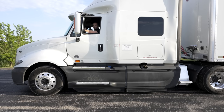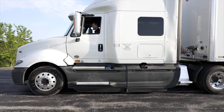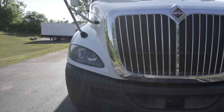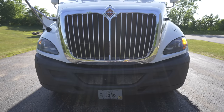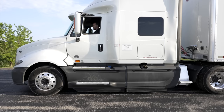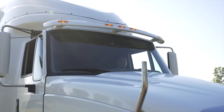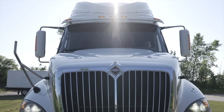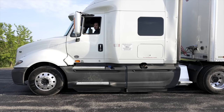Today we're going to start off with the front of the truck. When you get in the truck, make sure you have three points of contact at all times. The first lights I want to check are my left turn signals. The left turn signal is on — the examiner will tell you if it's good and working. Then I'm going to check my right turn signal — the examiner will tell you if it's good and working. Then I'm going to do my four-way emergency flashers — the examiner will tell me if they are good and working. Then I will turn on my headlights and tell the examiner to check my headlights and clearance lights. The last lights I'll check on the front are my high beams — good and working.